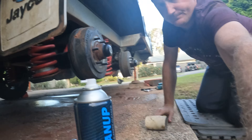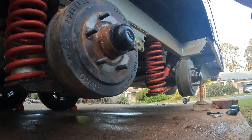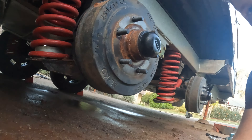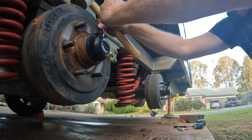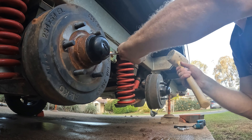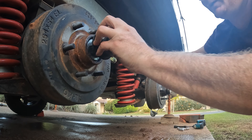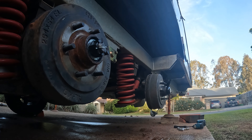Now that's off - you've got the center cap on the drum. I pretty much just get a fine tip screwdriver, come on top and then just work your way around. I'll get a bigger screwdriver, twist the head and pop the cap. Grab some rags and bend your split pin out.